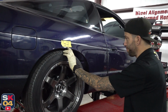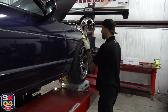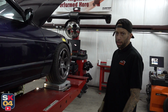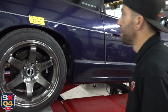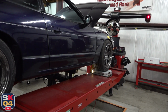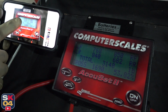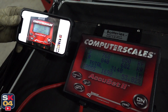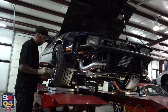Literally, this needs to go 0.2 centimeters down, and this one needs to go 0.234 centimeters down. So that's it, and that would actually help out with our weight problem we just created by lowering that side. It's amazing how precise we can get when we actually find a good measuring spot, huh? Yeah, rockers, not roll fenders. So by lowering the left front, you almost put it back where it was. Yep, back and forth, back and forth. Yep. Well, now we've got to lower the other side.